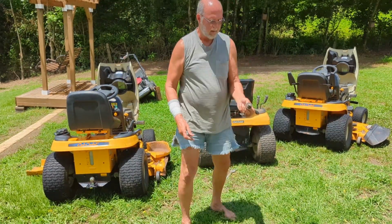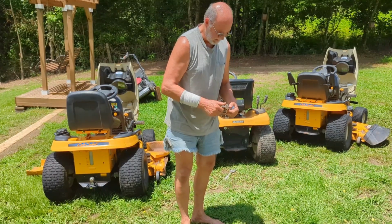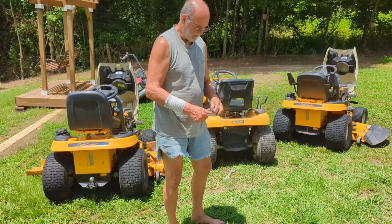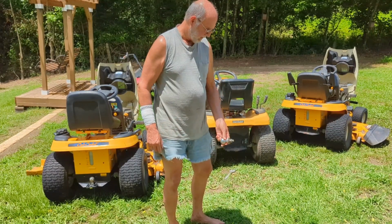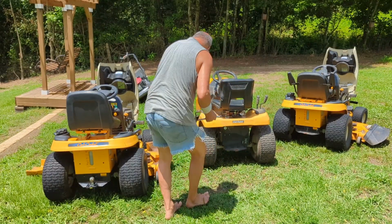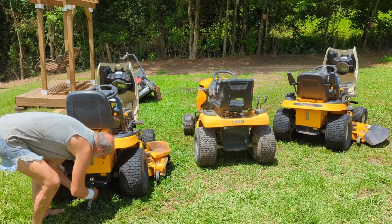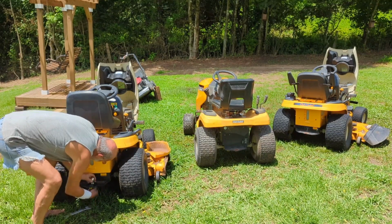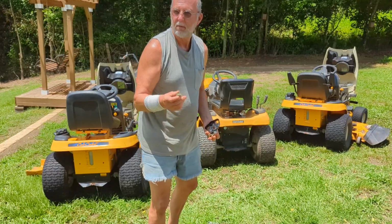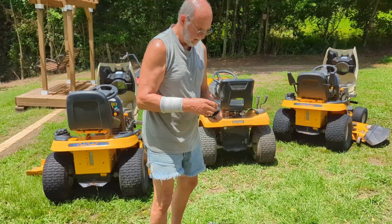This hitch ball has a 1/2-13 thread on it. I bought this a couple of decades ago, and I was trying to find another one, and I haven't been able to find another one with a 1/2-inch diameter thread, or stud, on it. This one probably has some metric size bolt. It's almost a 1/2 inch, whatever that is in metric, but it's a fine thread.